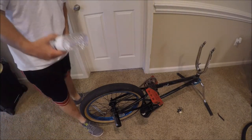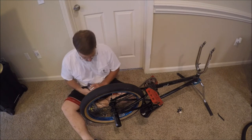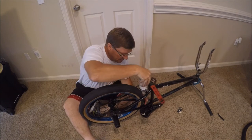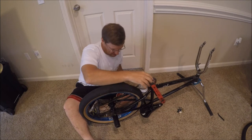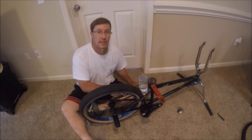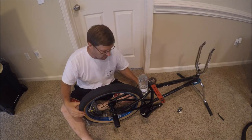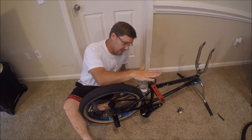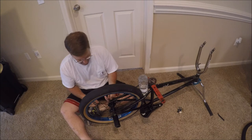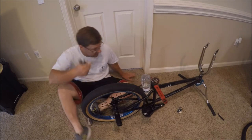So you've got a loose chain, or your chain came out of line because you did a grind or something. Here's a cool tip: take a water bottle — it helps if it's kind of full — and stick it down inside between your wheel and your frame. This lines everything up, keeps your chain tight, and gives you hands-free where you don't have to ask your buddy to hold your tire. Stick it in there, then tighten one side and then the other.